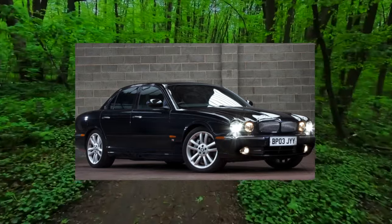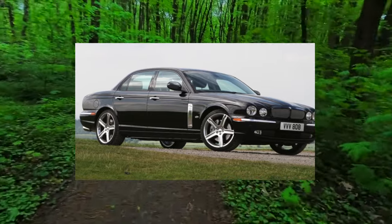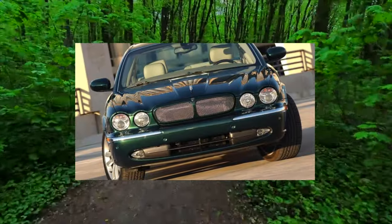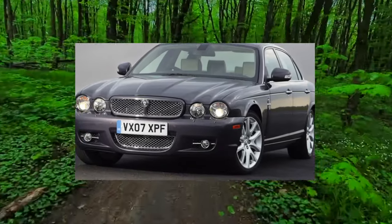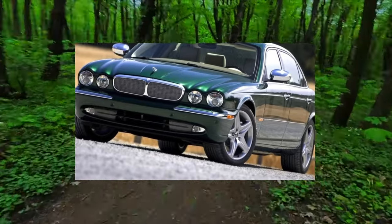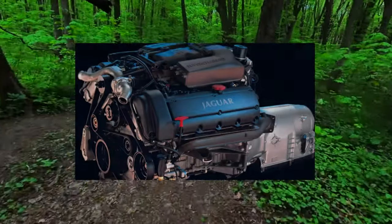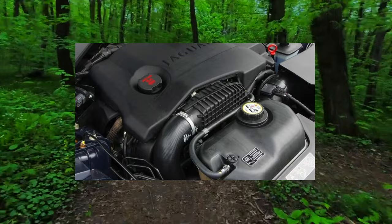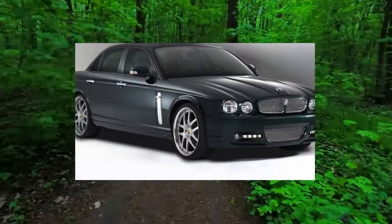Typical small chips on the edges of the doors, scratches on the hood, and sandblasting on the arches are usually removed without completely cleaning the parts, and the factory sandwich of coatings remains intact. But when the body is completely painted under the thickness gauge or when new parts are installed, the paint peels off in layers. Some services try to set the price for paintwork five times higher than the market average citing the high cost of materials, though this is usually not quite true. On the X350/X358, the build quality of the body is simply amazingly high — very even in small gaps — so any deviations from the factory are signs of repair.